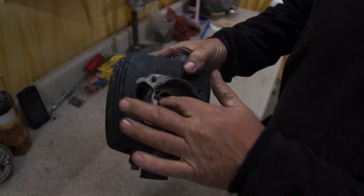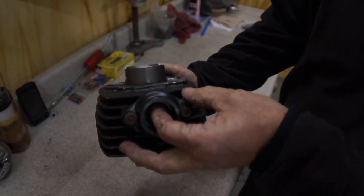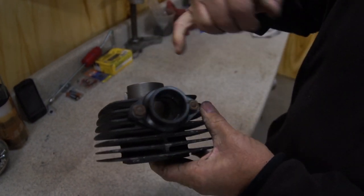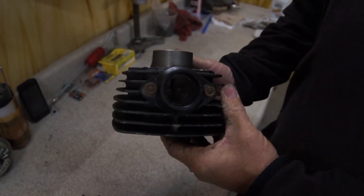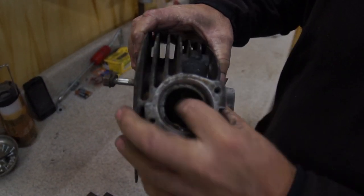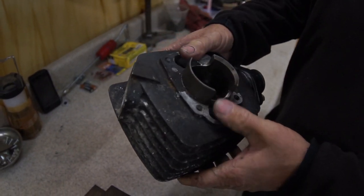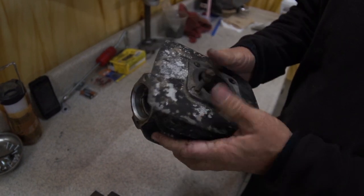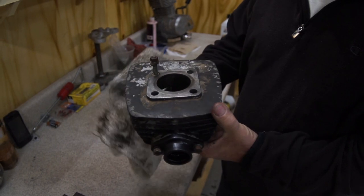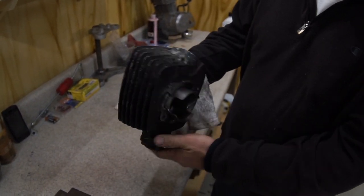You can see how the fuel air mixture will flow real nice. And this is a nice flow from the 28 millimeter into the 26. We sharpened up the bridge on the port. There's the air compressor going off. That's always helpful. And we sharpened up the bridge on the exhaust port too. So this puppy will run really good. We just need a good rider for it. So once we get this barrel cleaned up, we'll paint it, make it look like the head, and it should pick up a few horsepower.